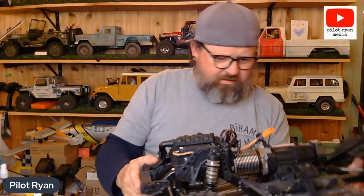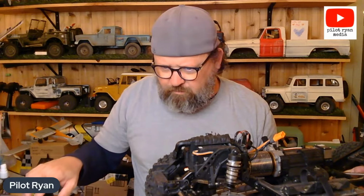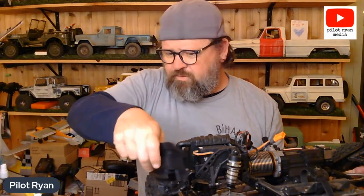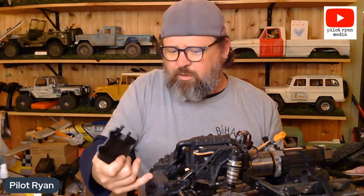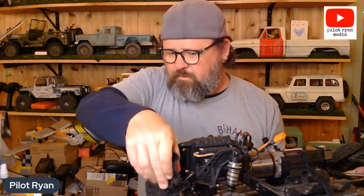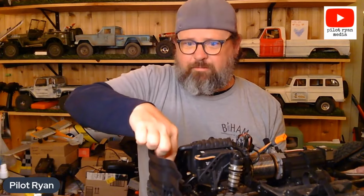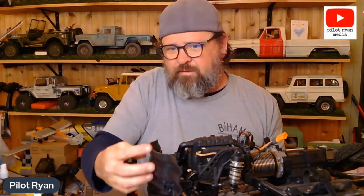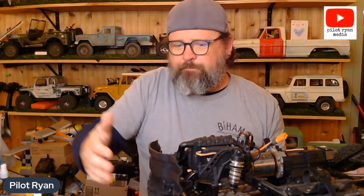On the Chevy, I have this front end as well. So it goes in there. You can see the rectangle is going to fit right here on the cross member. There's stock holes already for where the bumper went in. So pins in, and then bolts to the rectangle. So that keeps this in here really firm. The body keys into this, all this contour and groove that's in the bottom notch, and holds it.